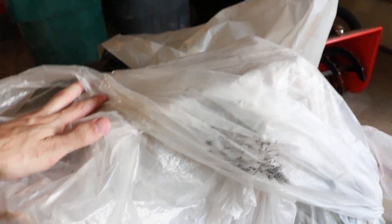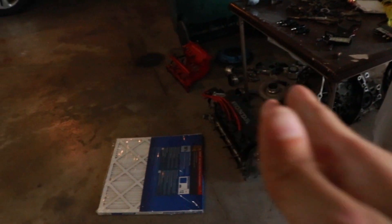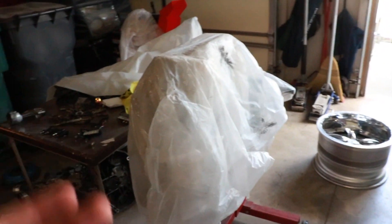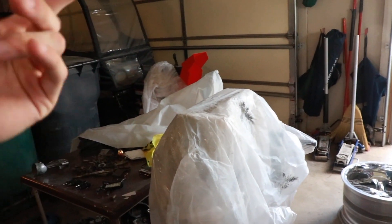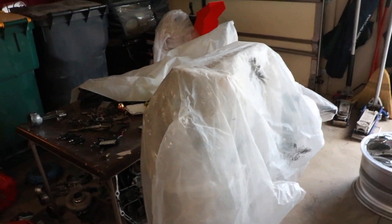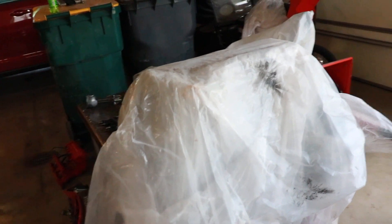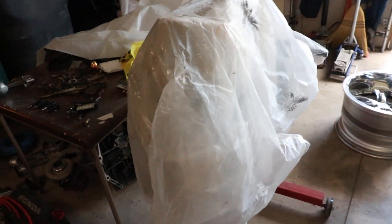Update on the engine: this is just the block and head for now. There was something I didn't like — the clearance where the edge of the cam sat on the front of the head was bad and tight. Also, it didn't have the oversized titanium valves — it had Tomei cams, retainers, and springs but not the valves. Since the engine was already back together, I said screw it and decided to get a new head. I dropped the head off at the machine shop in January 2019, it sat there for a year, and then they ruined it.